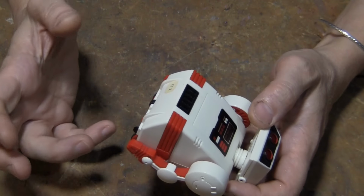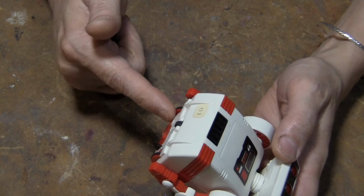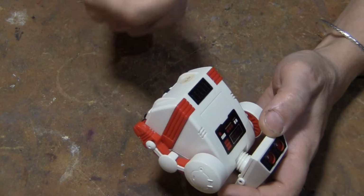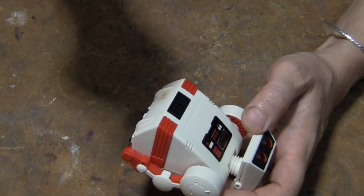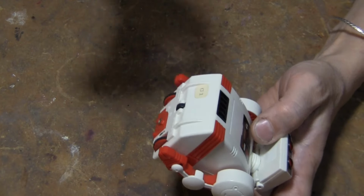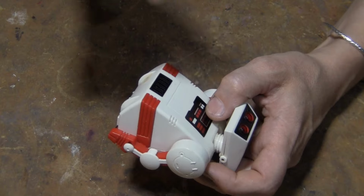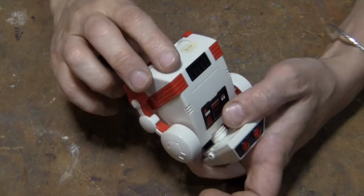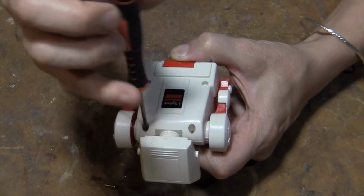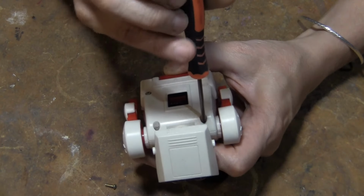Now, what happens is the motors get gummed up or oxidized, and they're just not making good connection on the brushes on the commutator. So if you could just get it to go just a hair, it'll make the motor move a little bit, which will make it clean it up a little bit, make it move more, and so forth. I gotta admit, I do love when that happens, especially when I get it on camera.